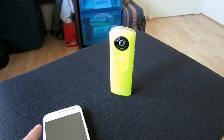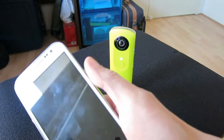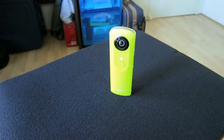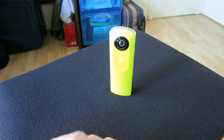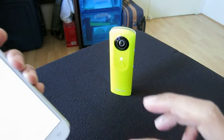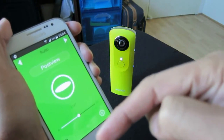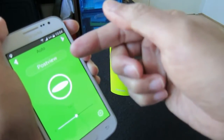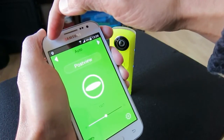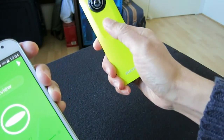The problem is if I walk along with my phone on standby, the GPS information is not updated. So if I take a photo again with the built-in shutter button, I will have the wrong location information. Of course the safest way would be to take a photo from the app. But if you don't want to, you can launch the app again and wait until the GPS information is updated, as you see at the corner here. Then you can take a photo with this button.